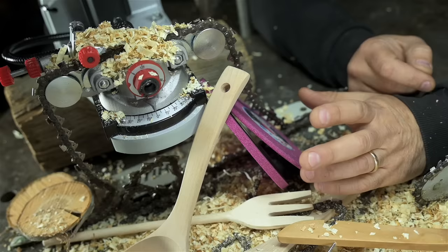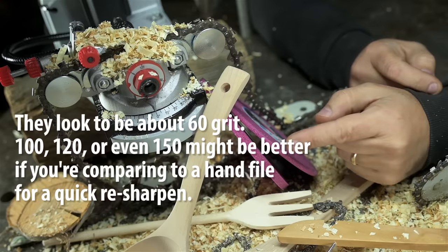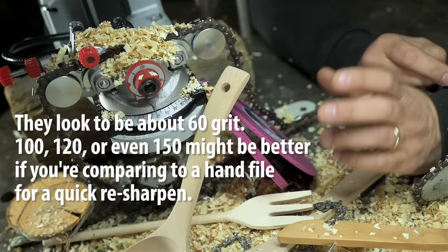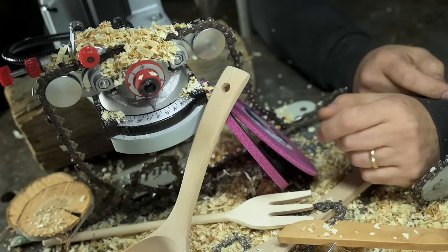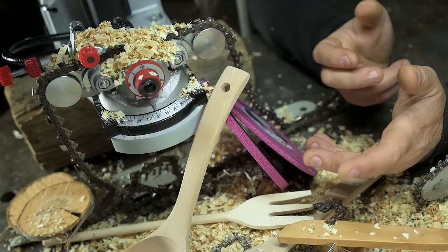Though, since you brought it up, I don't think these grinding wheels are doing you any favors. They're okay. I got three with mine: a 3/16, a 1/8 that I've been using almost exclusively, and then this flat one for dropping your rakers. These aren't the finest grinding wheels money can buy. Let's put it that way. If I end up using this thing a lot, my first investment will probably be better grinding wheels. Maybe a slightly finer grit and something that grinds a little cooler. For home game sharpeners, we don't really need to remove this much material that fast. And again, if you're cutting into a lot of roots, maybe you do.